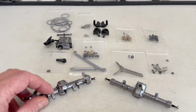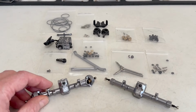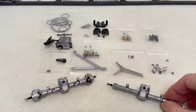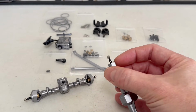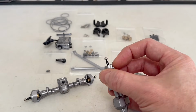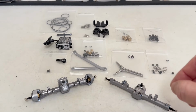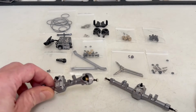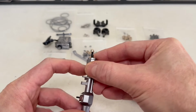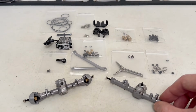The second little quirk with these that's known is you've got to shim the servo tray. I usually do that with some 3M double-sided tape, maybe 1 or 2 layers, whatever's needed. That snugs it up and keeps it from rocking. The last little item would be the hex fitment. Because of where the pin is, a lot of times if you tighten the wheel down, the hex won't seat on the pin before the backspacing starts crushing into the bearing. That's why you get binding. So I typically get the +1 hexes and sand off some backspacing so they fully seat on the pin. The reason I get the +1 is that, since they're pushed in further, they have a little more face out to the thread, so you don't have any problem tightening a thin wheel hub down. Just those 3 little quirks that I've noticed using these over time, no big deal.